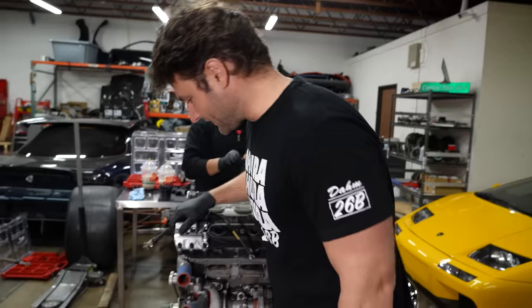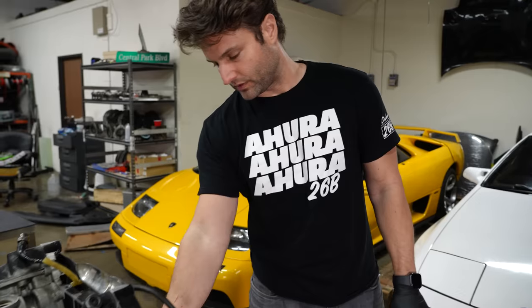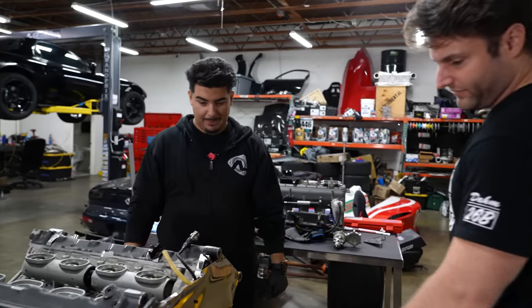It is time to start taking off the easy parts of the motor. I've already taken pictures of the clutch and measurements — this is a five and an eighth inch, as I said briefly, and I've sent them off to Tilton and some others to see if we can get a clutch for this. Isaiah, if you want to get the 12-point socket out, we're going to pull that flywheel off.